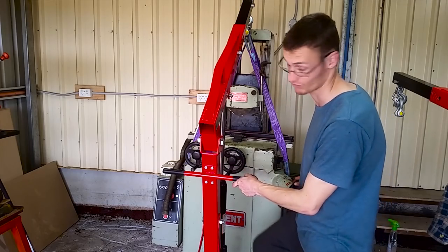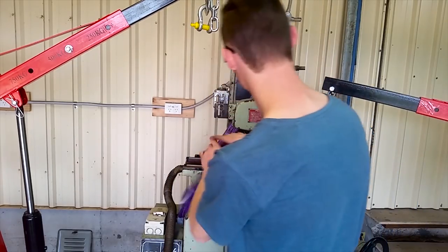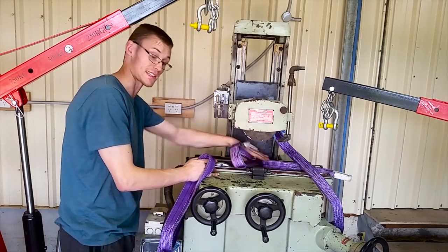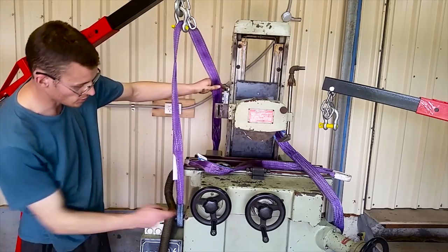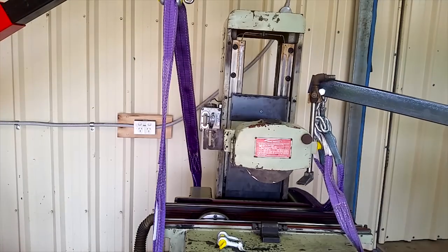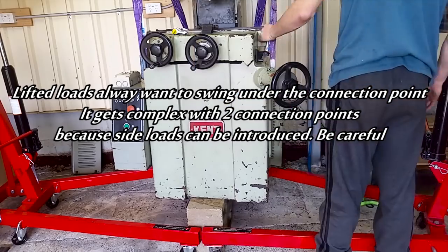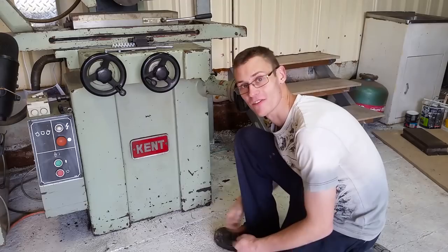Time to get this thing off bricks. Here's where things will get dodgy. Rather than crossing the diagonal, I'm just going to go on one side. This is dangerous, it's less stable. The problem is these can slip off — extremely dangerous. One benefit of this arrangement: the engine hoist legs actually brace against each other, otherwise they'd be able to take off to centre under the load. And the Eagle has landed — finally got off bricks.